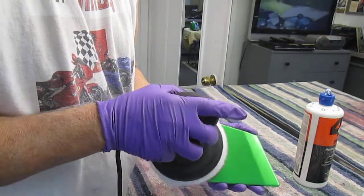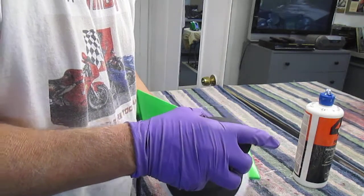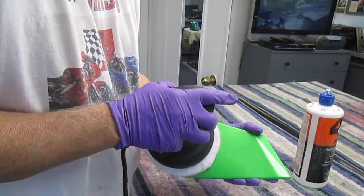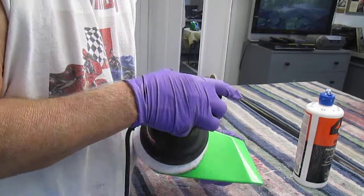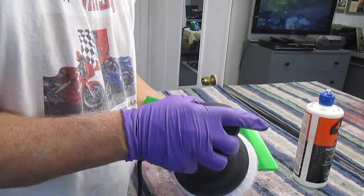See, when you're working under fluorescent lights, it shows all the mistakes. When you're working under incandescent light, it masks all the mistakes. So any shop that's really doing very high quality work, you want all the lights to be fluorescent, because the fluorescent allows you to pick up the mistakes with your eyes a lot better.